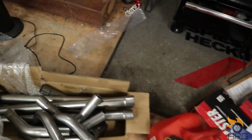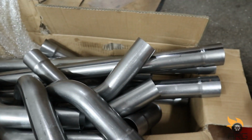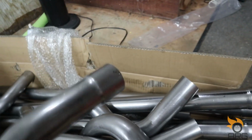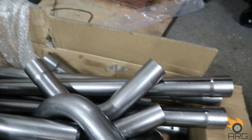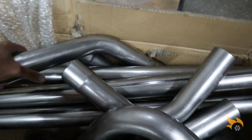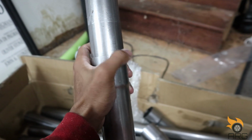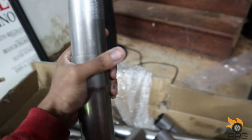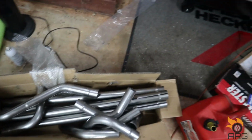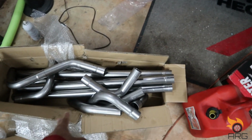This custom kit, what I do like about it is this is all 2-inch piping. You can get them in 2.5, 3-inch, whatever. I got it in 2-inch, and what I like about it is that on each pipe, one end is oversized just a little bit, so it's easier to slip through like that. Instead of butt welding, it slides in and then it's easier to weld, especially for a beginner like me. So I really like that about this kit. Like I said, I might have a link to this kit in the description.